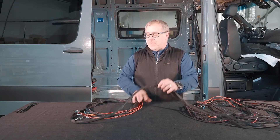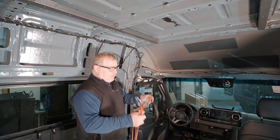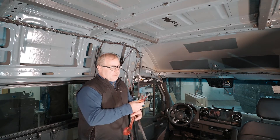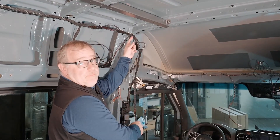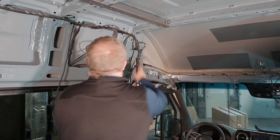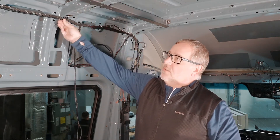Let's move on inside the van. I'll show you how to find the right location to start the attachment, and then we'll install the rest of the wiring harness. So we're in the van here. We've got the wiring harness attached across the top — ring connectors are going to head down to the bottom of the base of the driver's seat, and again, these are all nicely labeled for you. As we follow the wiring harness up, we come to this first bifurcation point, and that's where we have a zip tie right at the standoff from the factory wiring harness. We can then continue to cross here, and at every one of these standoffs we are going to add another zip tie and secure the wiring harness straight down.